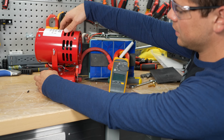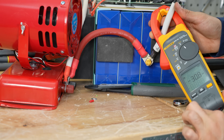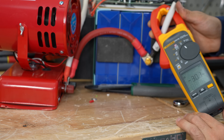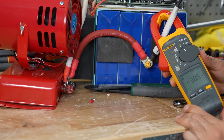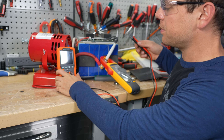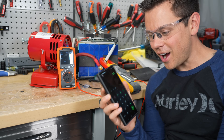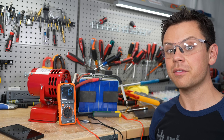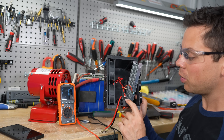The fan did not turn on, but the resistor coil did turn on. The first switch is for the fan, and then the second one is for the heater. Let's turn on the heater — it's pulling 30 amps. It's not changing at all. Let's flip the switch and turn the fan off — it'll probably heat up. That doesn't sound good; it's getting too hot, I need to turn that back on. And now it smells bad. I don't know why it has a switch to turn the fan off completely — that's a fire hazard. The voltage is at 12.5, so 12.5 multiplied by 30 is 375 watts. And it's supposed to pull 1,000 to 1,200 watts. So out of four units purchased, three of them were pulling about one-fourth of what they're rated for. This one didn't reach its rating either, but it almost made it — and it had the worst build quality inside.